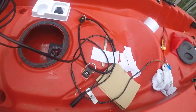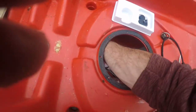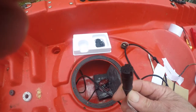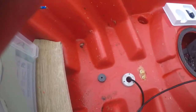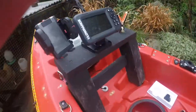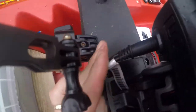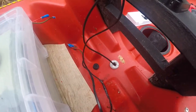I've now attached that little bit just there. All this cable I've now coiled up and I'm going to push that temporarily up to the front — like that. I will cable-tie that when all this has gone off. So the transducer cable is going to come up through that hole there. That cable is going to go to the battery box. My head unit sits like that on this footrest while I'm kayaking. I just need a bit of slack — perfect.